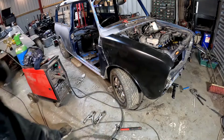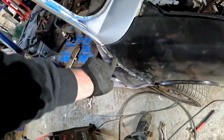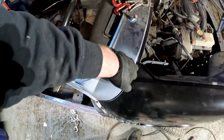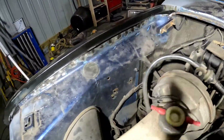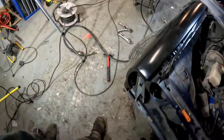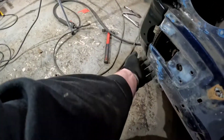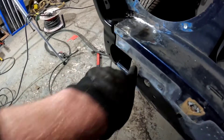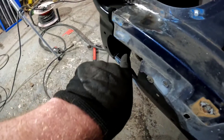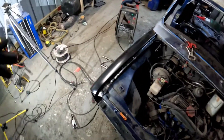Welding's done. I'll walk around and show you what we've done. Weld's down there holding the A-panel to the wing — they just want tidying up now. There's three spot welds across there, there's three spot welds in there. It's lighter round so you might be able to see a bit better. And there's the welds across the inner wing there — they just want dressing up a bit now. What I've got left to do is the spot welds inside here. This lines up more or less, just wants a little bit of fettling. I need to get it up in the air, get the wheel off, and spot weld on the inside of that seam. Then the wing's on.